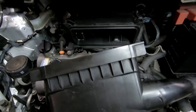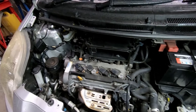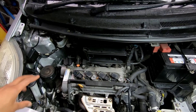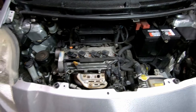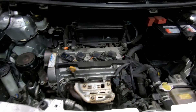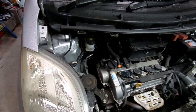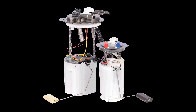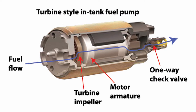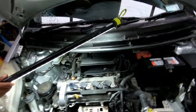This particular Toyota model does not have a mass airflow sensor — it's got a MAP sensor, but different models have different sensors. A faulty mass airflow sensor is a common issue on Subarus, especially if aftermarket pod filters are fitted — it clogs up the filter with oil and it doesn't operate properly. The third thing in the air department is sometimes your fuel pump might also be playing up. Try and listen if it's running — you can even get underneath and just tap the tank.